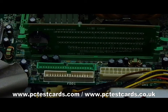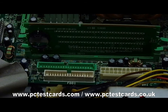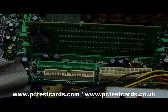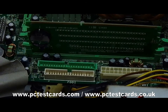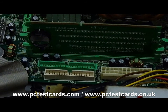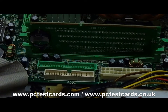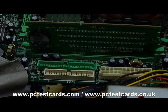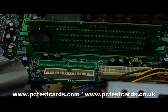Hope this video helps you to know how to install the RAM tester and some precautions. Again, before installing the card, please make sure to discharge the motherboard by removing the power cord and pressing the power button for over 20 seconds. Then install the card and press the switch button on the card. Hope this helps — any questions, please let me know. See you later.